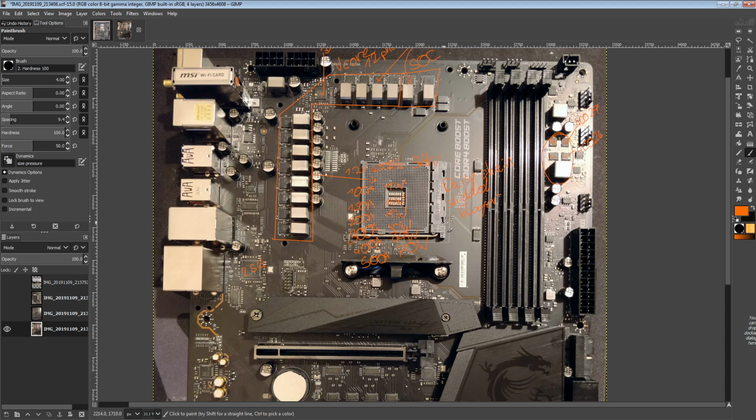Because I have zero doubts that this will do 3800 megahertz. I'm basically just going to do a max frequency test, and I expect it not to beat the Godlike, because the Godlike just has more layers to do the same thing with, so it can do it better. But the thing is, the X570 Extreme, or say the ITX, the ITX just has the advantage of less distance and fewer DIMMs.